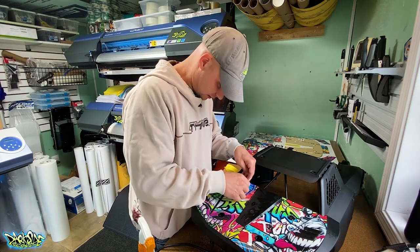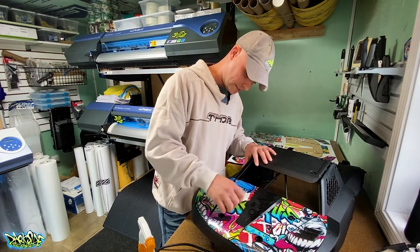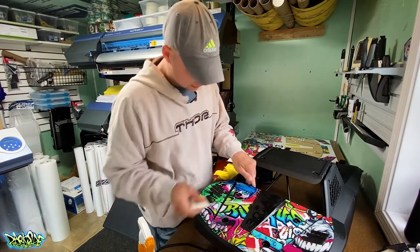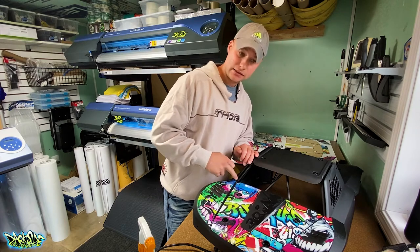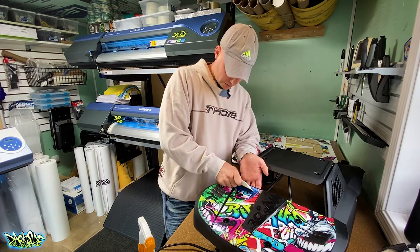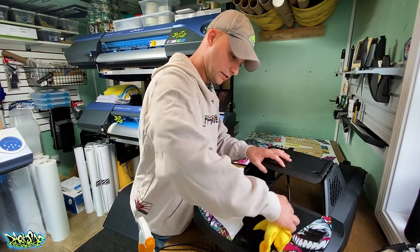This is falling right back into place using the hinge method. It's not going anywhere now. I'm going to work it with the squeegee. The objective is to get the valley down first before letting it adhere — if you don't, you put a lot of tension on the valley and it could pop up. Add a little heat if needed. No air bubbles at all on this side.